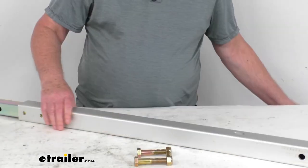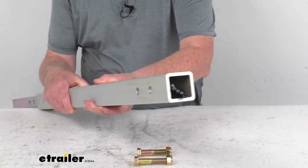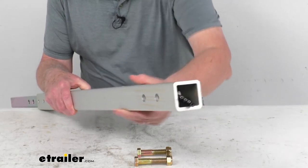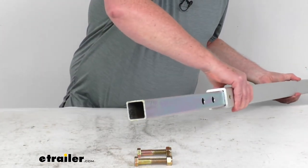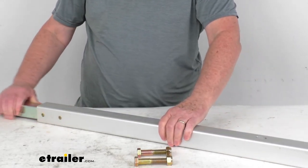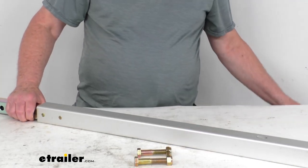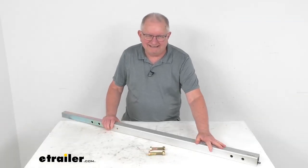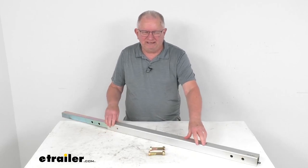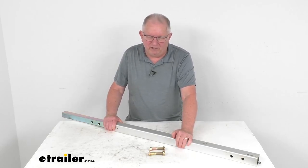To show you what we're talking about, I'm going to zoom in and lift up this end. You'll see there's your four-way plug right there that you'll be plugging in, and on the other shank end you'll have another four-way plug. Make sure to make those connections before you put it all together and tighten it down. Then you'll slide the whole tongue assembly with the extension installed into your Yakima trailer and plug the four-way connector into the four-way on your trailer.